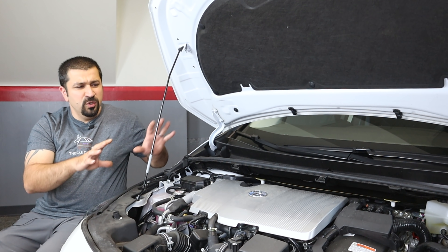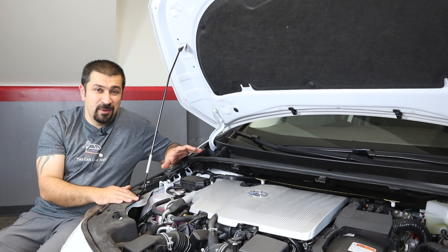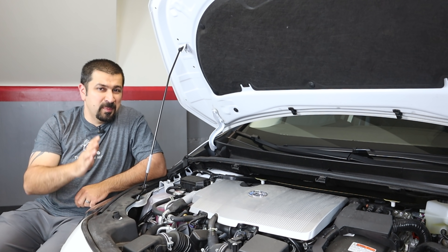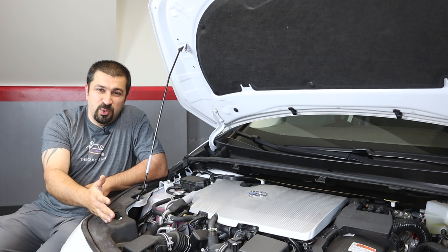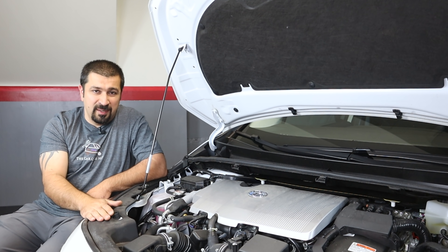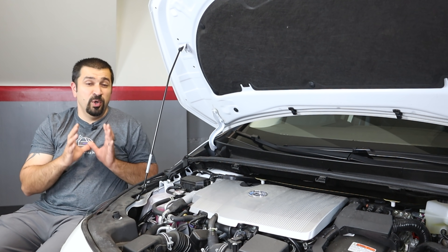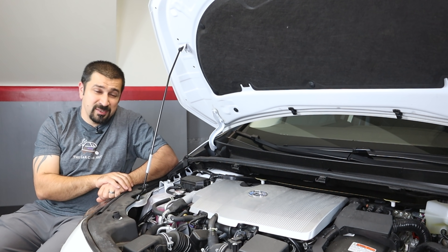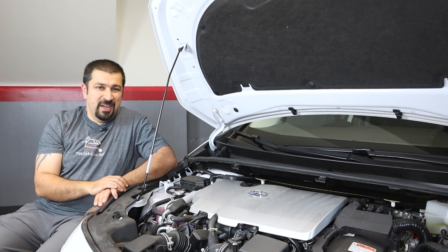In order to give you more power up to 84 miles per hour, they had to change a few things. Remember how MG1 only starts the engine and charges the battery — it doesn't drive the car? Well they had to change that. Now, instead of only MG2 driving the car and taking all the heat and stress while the engine is off, MG1 also drives the car in plug-in hybrid mode.